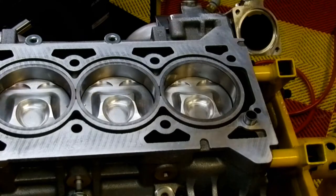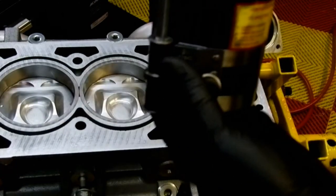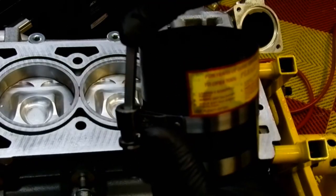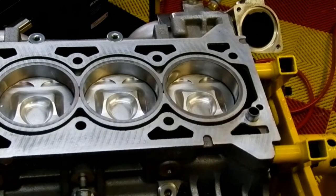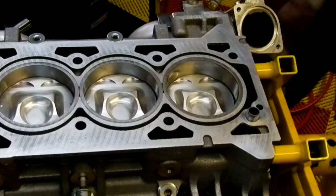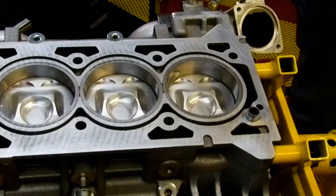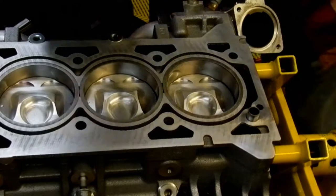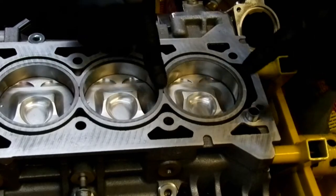And just so you know, if you want to save your ring compressor, don't just hit the switch here. Put your Allen key in and let her out smoothly. Otherwise, you'll break the compression springs. Okay, we're not done yet. Let's get rid of the big hammer. Have a drink. That's looking good. That went in real nice.